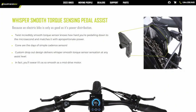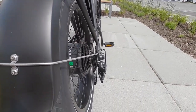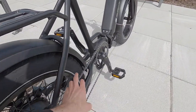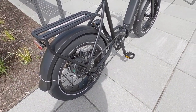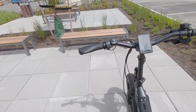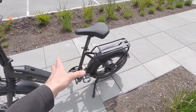The torque sensor gauges how hard you're pedaling and pushing, not just how fast you're pedaling — not that on-off experience you get with cadence sensors. That's kind of unique. One trade-off, however, is if the chain is bouncing a lot, that can activate the torque sensor sometimes. I experienced that when I was riding off-road — it kind of caught me by surprise. The good news is both brake levers have motor inhibitors, so you can override the power at any time — not a big deal.